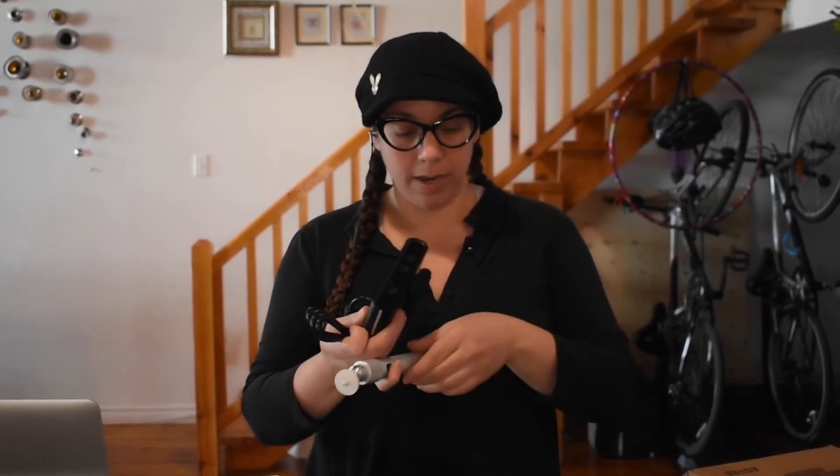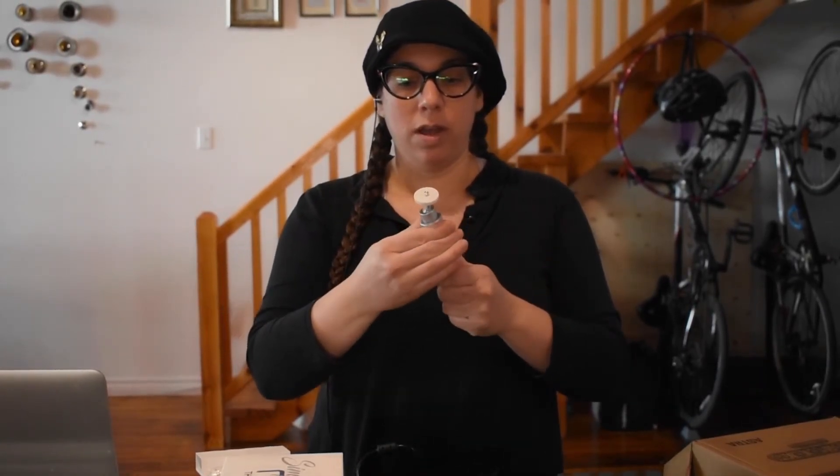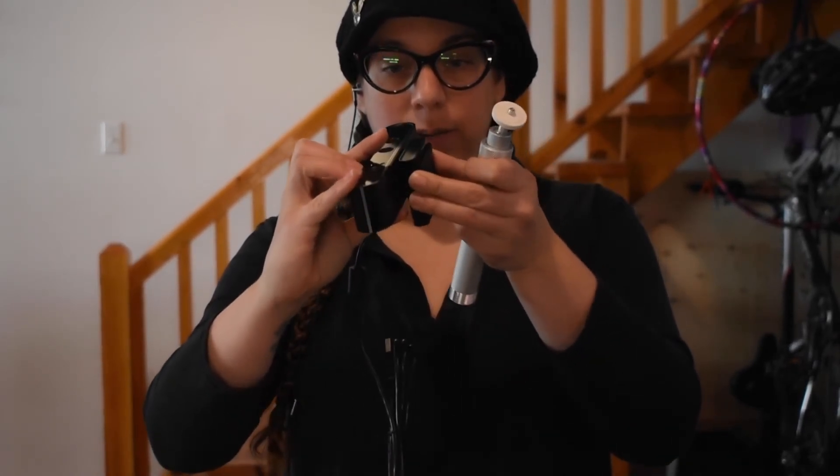The main thing to know about this camera is it does come with mounting hardware. This is a two-piece mounting system — this base plate goes onto the wall or ceiling where you're installing the camera, and then this piece screws into the base plate and the camera goes on here. With this camera mount you have a swivel on the top — if you loosen this piece, it swivels quite a bit. Use this swivel to position your camera. With the Orbeck, there is also a bending piece at the bottom. Our recommendation is to tape this down and just use the swivel on your mount to position the camera, because this bending piece doesn't lock into place — if it gets moved you have to recalibrate. It's always better to use a locking piece when positioning your camera.